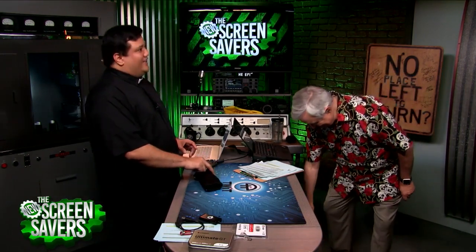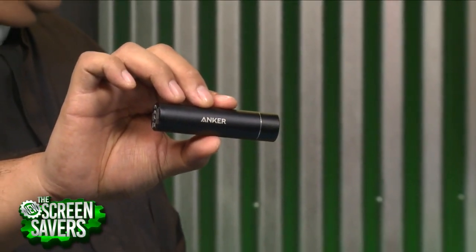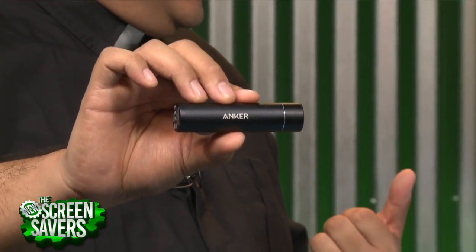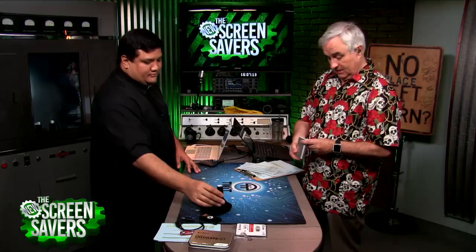What else? As long as you're dropping USB condoms on things, let's talk about some safe power. Bring your own with you — it's the only real way. I actually have a five-pack of these because people are always asking for batteries. This is an Anker PowerCore Mini, $14 — you can get them for under $10 each. These are 3,350 milliamp-hour capacity and do one amp charge. As basic as it gets, but I could lose it and not feel too bad. It could give your iPhone or Android phone a charge.